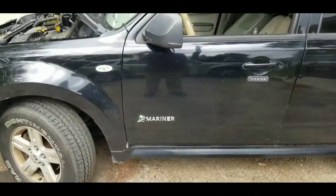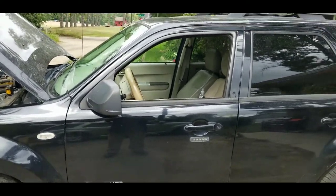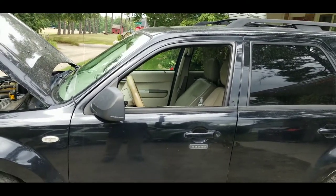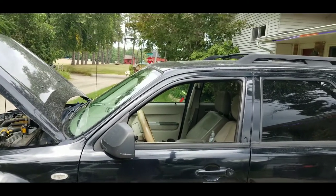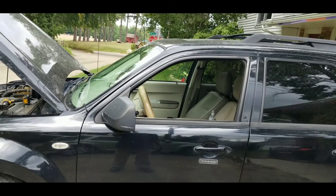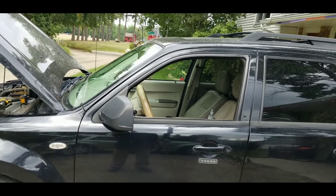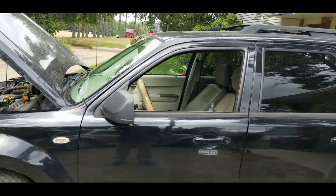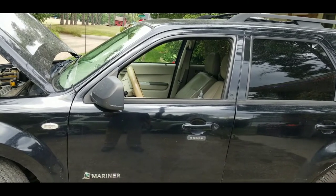Hello friends, we've got another car repair video today for you. We've got the 2008 Mercury Mariner Hybrid and there's an ongoing intermittent problem when the car first sets out in the morning. You'll try and accelerate and go down the road and you'll get no response from the accelerator pedal. It'll just die down to an idle and won't rev up. You put it in park, shut the car off and restart it and then it's fine, usually for the rest of the day.